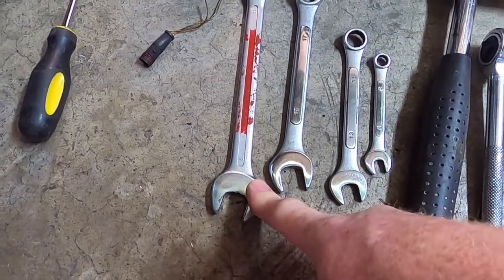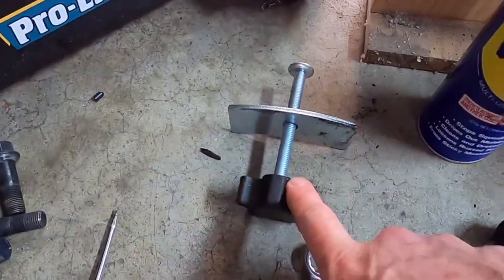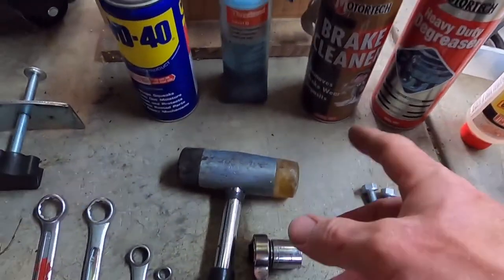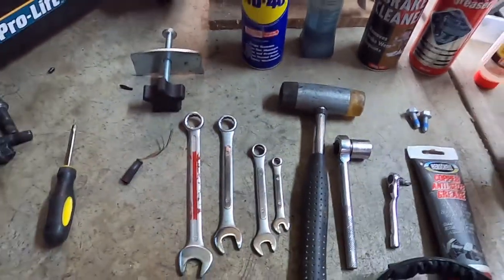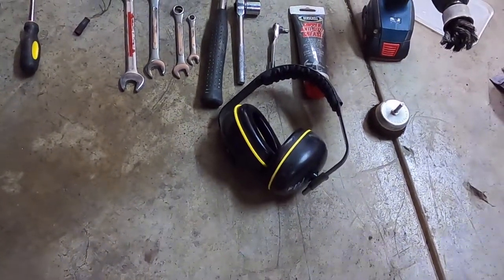And an 18 to do the actual bolts on the brake carrier bracket. Some kind of pad compressor to push the pistons back in, maybe a screwdriver to clean some stuff up, and then I used some rust converter, some degreaser, a bit of brake cleaner, some thread lock, and a bit of WD-40 to clean things up. And maybe some ear protection and some eye protection to keep yourself from getting hurt when you're doing that job